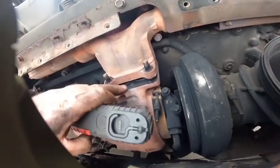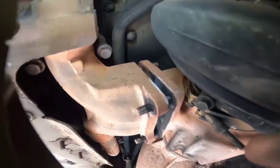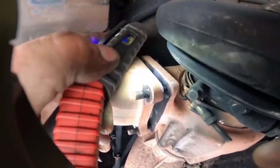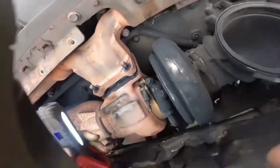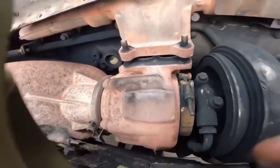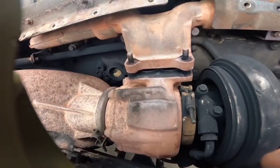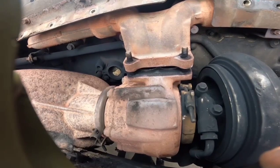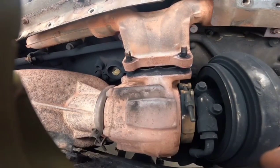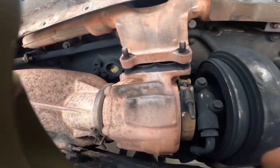Right guys, I've dropped the turbo down as far as I can. I don't know if you can see that, but you can probably just make out the blown bit of gasket in there. So I can't get those back studs out. They're seized in solid. The bottom brackets are tight. I can't get them to move on the bottom of the turbo. I don't want to shear anything off. So what I'm going to do, I'm going to get these 2 front studs out that I can get to, and I'm going to do a slight modification on the new gasket, which won't make any difference to the gasket sealing, and I'll be able to slip that in and job will be a good one. Save loads of time, loads of hassle, and save everyone the bother of having to take all that apart, which doesn't actually need to come apart.